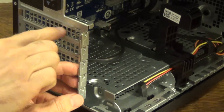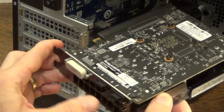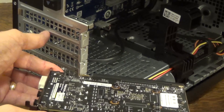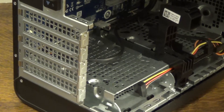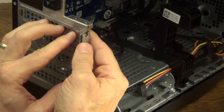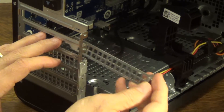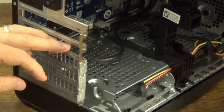So the way you want to take a couple of these slot covers out — if you look at the particular graphics card, it's going to be sitting in like here, and you can see it's kind of wide on this end. These little plugs right here are going to fit in this little slot here, but we do need this one removed as well, so we need to remove two of those little slot covers. Now most computers you actually just need a Phillips screwdriver to remove these. This one you just sort of pull it out and you can pop these things right out, and they come out pretty easily.